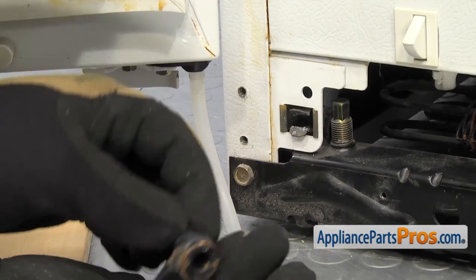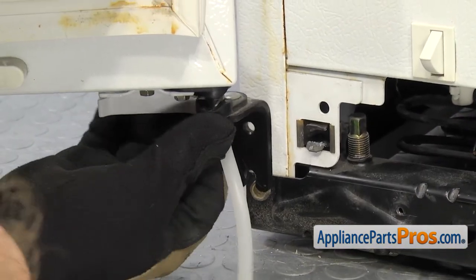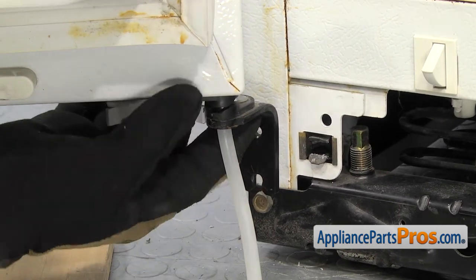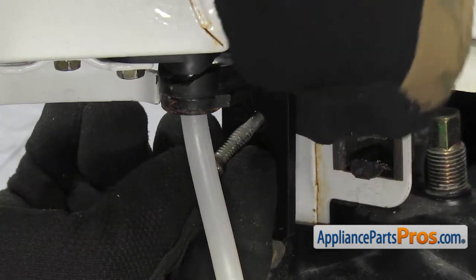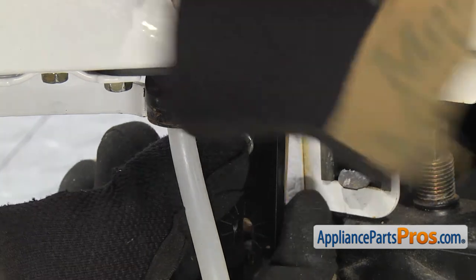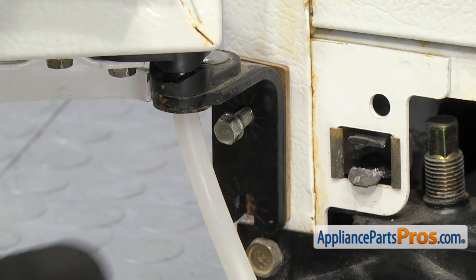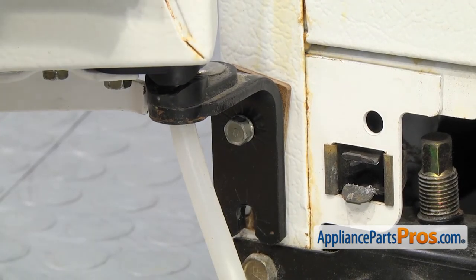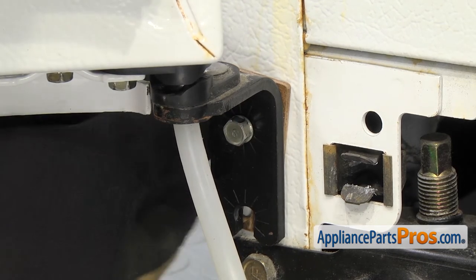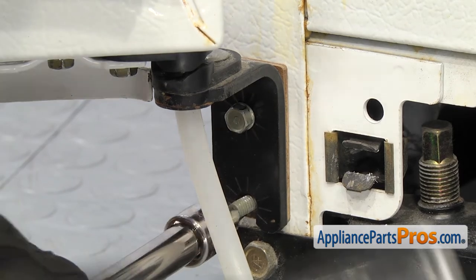Now that we have everything reinstalled on the door, we can put the hinge back on. All you have to do is grab the water line and put it through the hinge pin and slide the hinge up to the door, putting the hinge pin into the door hole. Once you have it in place, we can take our spacer and one of the bolts and put it through the hinge so it holds the spacer in place while we move the door around so the bolt goes into the hole. If you need to get somebody to help you, you can grab them. Once you have it in place, we can grab our 5/16ths socket with the ratchet and tighten it down. We don't want to tighten the bolt all the way because we have to slide the spacer and the hinge around so we can put the lower bolt in. Once you have it pretty snug, we can slide the hinge over and get the second bolt started, then grab our socket and tighten them both down.